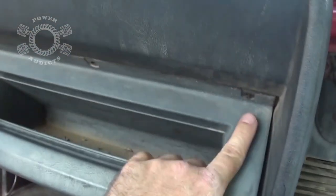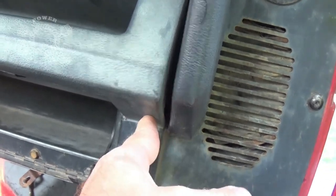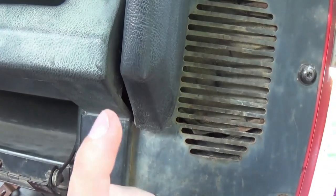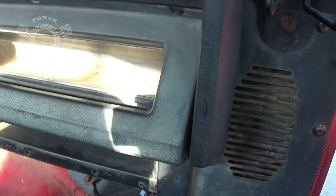So here's those videos. To start out: you've got three screws up top which I've already been missing for a long time. Take these screws out across the bottom — that allows the bottom to separate. The fun ones are behind here: there are two screws back in behind here and two screws in behind here. You've got to go upside in to get to them. I'm going to take the bottom ones out and then work on getting the ones back there. For these, a quarter-inch socket or a multi-bit driver works well. For kicks, I'm going to cram my phone up inside the dash to show you where those screws are located. Let's get a little focus going — there's the back side of the speaker, and there — see those two Phillips-head screws? Two on this side, two on the other side.